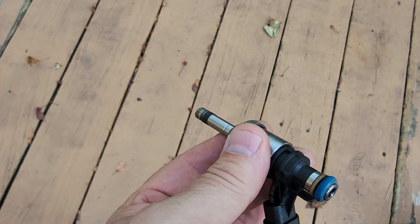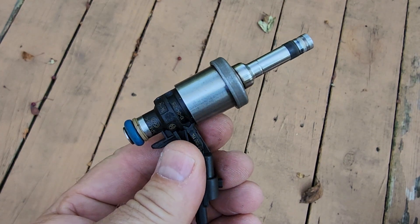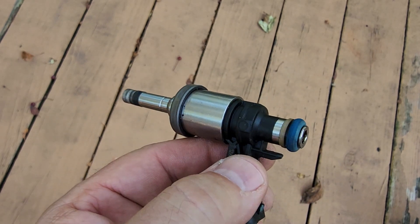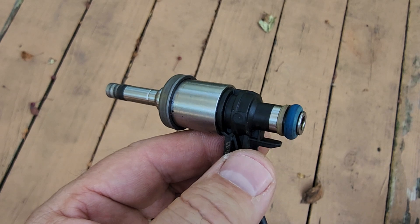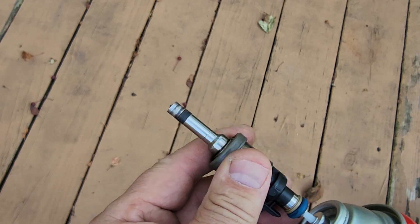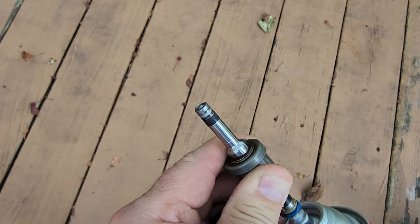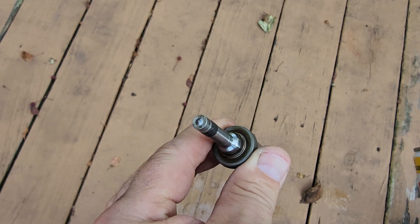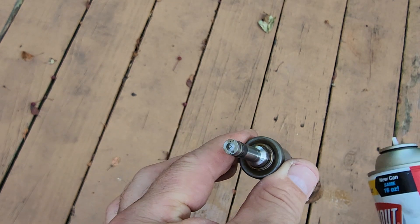What I want to do next is get the broken unit and hook up my tester to it. This is the broken unit — it does click, so that's good. I'm going to shut off the clicking and retest to see if this thing still leaks carburetor cleaner through here. It's dripping — you can see it drip. So this is what you call a leaky fuel injector.